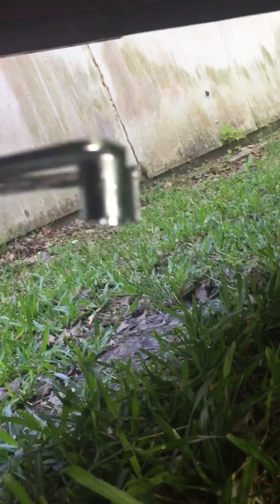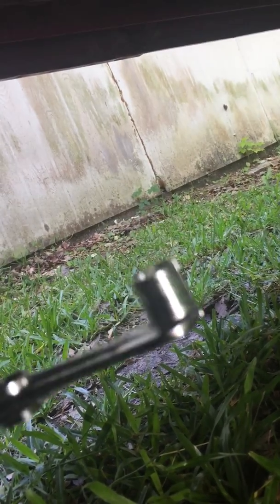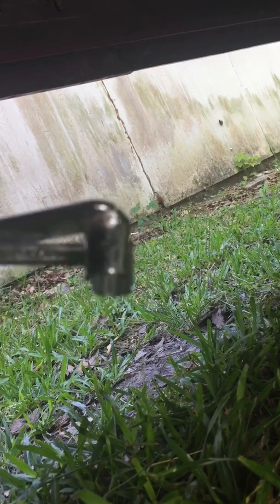You've probably seen it in other videos. I got this off of Amazon for, I think it was about 10 bucks, and that is a big help in taking the fuel line off. You need that. There's an internal retaining lock or spring that you have to push into the fuel line in order for the fuel line to release. I've seen some people make one out of a plastic Sharpie top. I liked it for 10 bucks. This is pretty easy. It's easy to manipulate the fuel line with it.